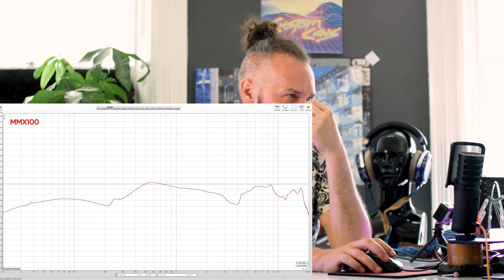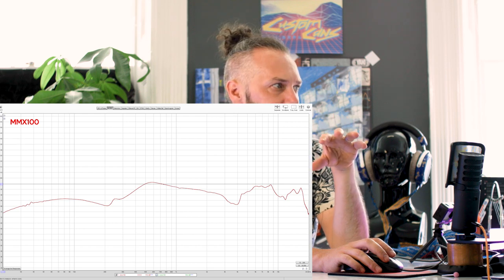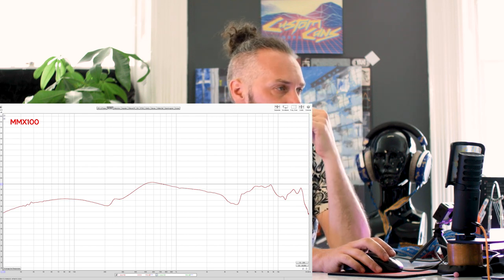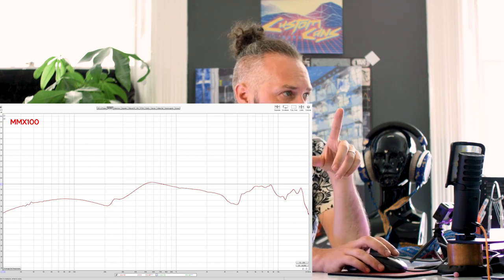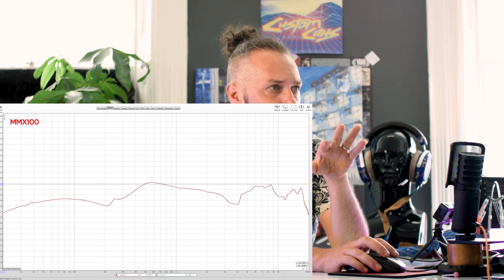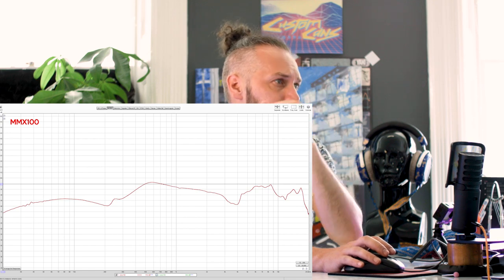It'd be interesting to get them on the test where you can see what the measurements look like. Very different sound signature from most Beyerdynamics - a very different frequency plot. They've got quite a weird hump around sort of 400 to 600 hertz, quite a big hump. And then the treble is a lot flatter than you get on most Beyerdynamics, where you normally get a bit of a peak in the treble. As I said, they sounded pretty good when I listened to them, but it's interesting seeing how they are tuned differently to one of their audiophile or studio headphones.